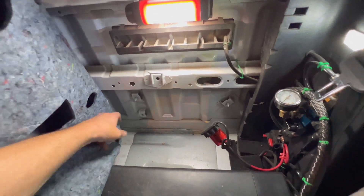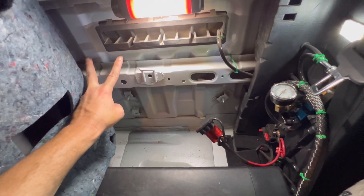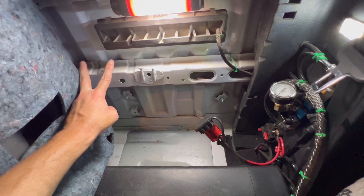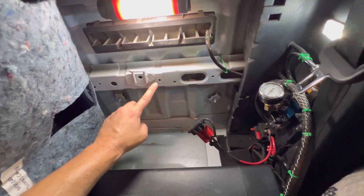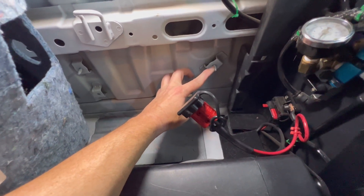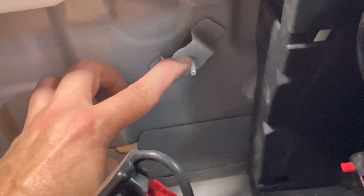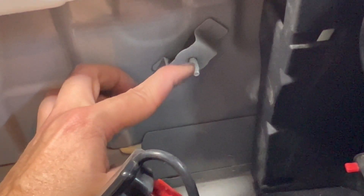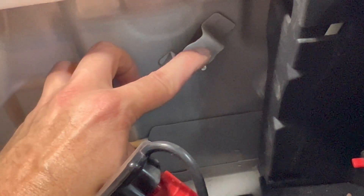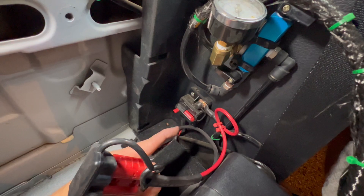In the back of the truck, I had the two ground points — the pieces are going to come out right around in here. Knowing the ground points are going to be on this side, I'm going to use this little stud right here. I'll clean some of this paint off quickly with a wire wheel to make sure we have a good connection point, then put a nut on it so we can ground it right there, and it'll come right over here for my power source.